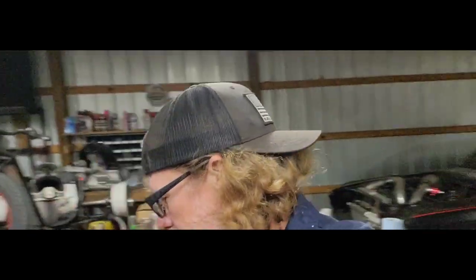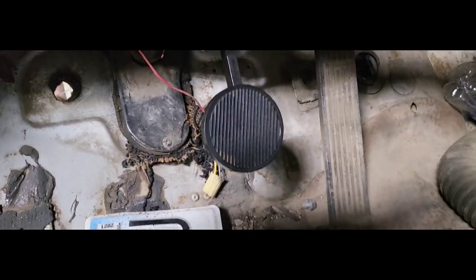All right, brake booster, master cylinder, and our little proportion valve is all installed in the truck. Also went ahead and just hooked up the little rod to our pedal. This guy's gonna be helping here real quick because we're getting close. But as you can see, as the booster comes through the firewall there in our little bracket, it just has this little clevis with a pin. So now it's pinned to our brake pedal, which is now sticking up. That is fully adjustable, so you can get your height wherever you need it. So that is cool. We now have a brake pedal inside the truck.